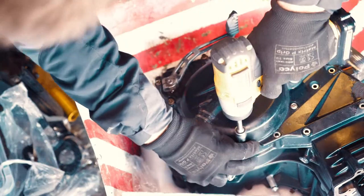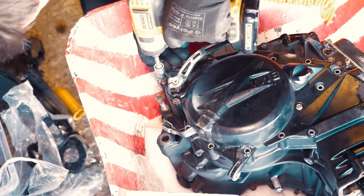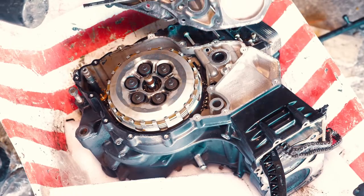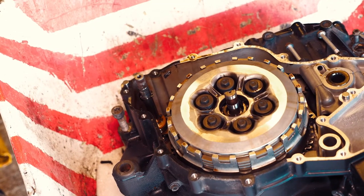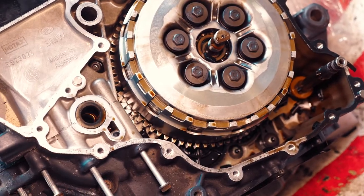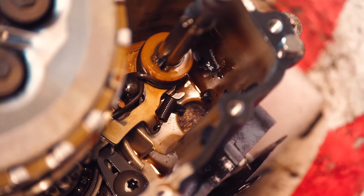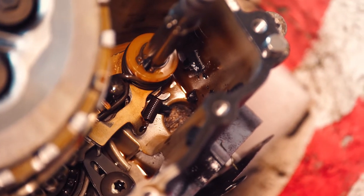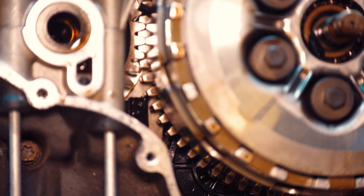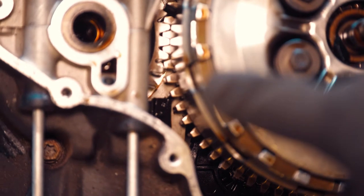We're back stripping down the engine. The first protocol was to take the clutch housing off. When I opened the clutch cover you could immediately see an explosion of plastic shards from both the cam chain guide and the oil pump sprocket. There were no teeth left on the oil pump sprocket when I finally took it out. I'm not sure what caused this but I knew pretty much straight away that I'd need to strip down the rest of the engine to clean these parts out.